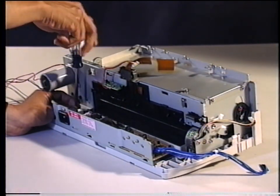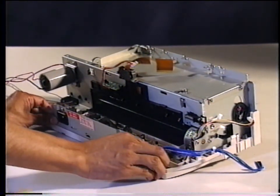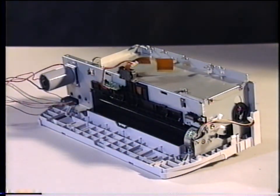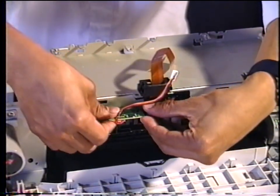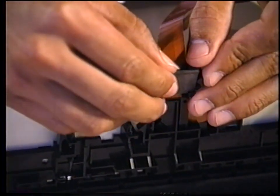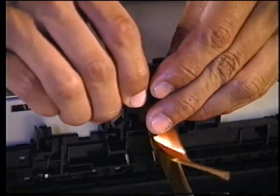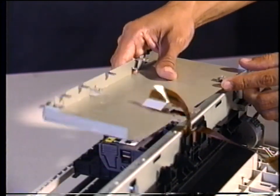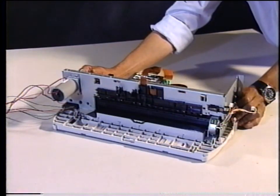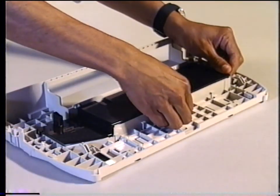Now let's continue with the disassembly of the printer. To separate the power supply, remove the screws on each side. Unhook this latch and pull the power supply toward you. Now detach and remove the paper and feed roller sensor PCB by unlatching the sensor from its sides. Remove the ferrite from the side latches to reveal the ribbon cable. Hold down the cable and then unlatch the ferrite holder from the printer's frame. Remove the metal plate held by these three screws. To reveal the ink absorber pad compartment, you must first remove the bottom cover. Disconnect the latch on the left and then on the right. Tilt the printer back, lift up, and out. To replace the absorbent pad, unlatch and remove the cover from the ink compartment.